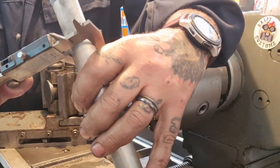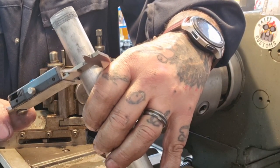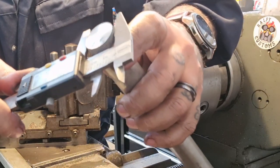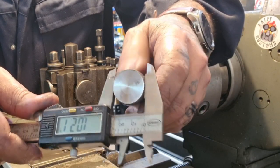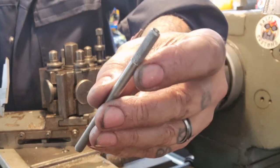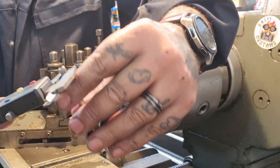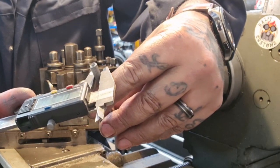So that's 1 inch, 6 thou, 8 thou is showing there, it's upside down. But when we go over to where we did that single point, it's now 23 thou, 22 is showing. Yeah, so it makes it a snug fit for things like pins, you know. It shows on this little bit of round stock better, because that's 0.247, so that's a quarter of an inch, near enough. And when we go on to the bit with the spline, it's 0.253 or 0.255 even.